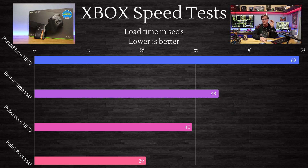Now for the game averages. One thing I noticed is that the game took a little bit longer to boot after a full console restart than it did when just closing and restarting the game — it must cache something. So I'm going with fresh boot times after a restart. For PUBG, fresh boot-up times before the upgrade were averaging 40 seconds; after the solid state hard drive upgrade, averaging 29 seconds — a particularly good increase.